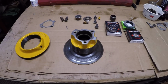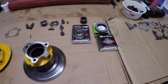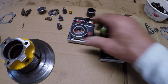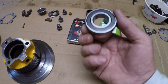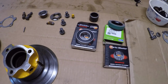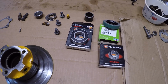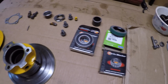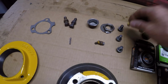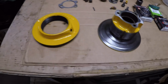Okay, here I am back on the water pump pulley for the 212 grader. Got my parts, got the seal I needed, 2 bearings. Bearings are sealed both sides. I'm going to install them that way, give it a try. That's more than likely going to outlast me and maybe even the next generation for the number of hours this gets on it. And what I am going to do also is eliminate the Zerk fitting and just put a plug in it.